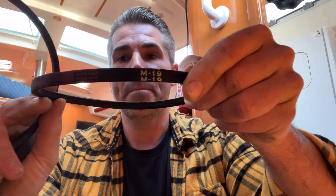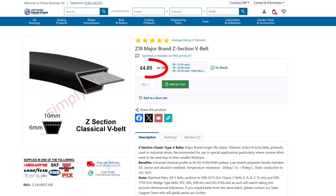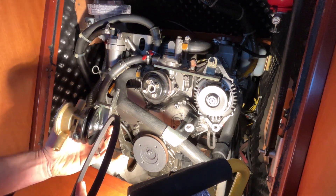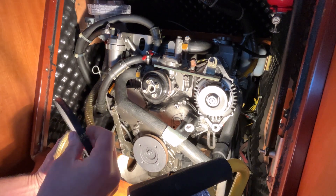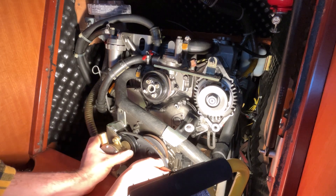I'm back down the boat with a selection of different water pump drive belts. The old belt was an M19 made by Mitsubishi — the M stands for the profile: 10mm wide at the top and 5.5mm deep. The Z profile is identical to the M profile in every way apart from being half a millimetre thicker. The Mitsubishi M19 fits a bit loose, so from Simply Bearings you can get a Z18 belt for £4.05 — about £6 with VAT and postage, saving you £19. The number after the profile is the circumference in inches. It fitted beautifully on the test run — it's a tight fit but just needs a bit of teasing in and slipping over the main crank pulley.